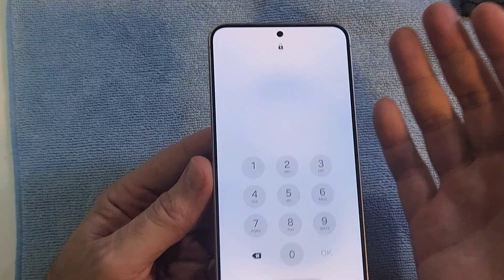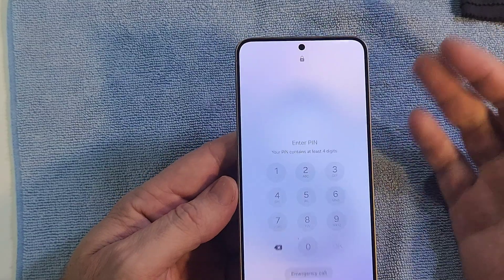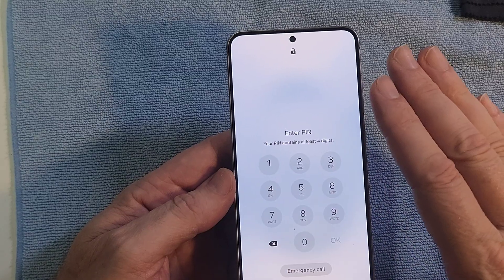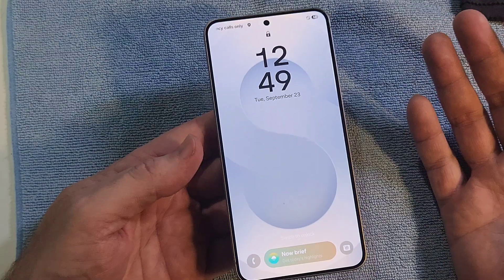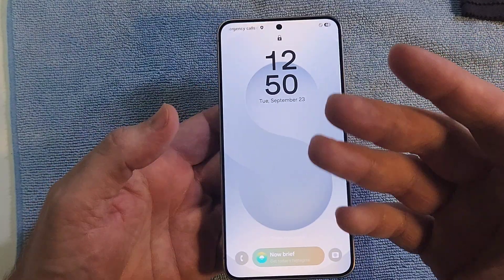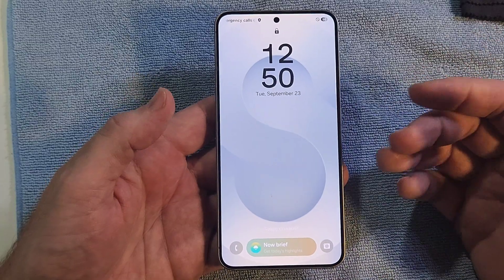What we need to do is reset the phone, but I'm going to give you two warnings first. The first warning is that when you reset your phone, you still need to log back in with your Google or Gmail account — you can't get by that. The second warning is that it erases everything: every app, every contact, every photo. With that in mind, if you don't want to erase your phone yet, it's worth making yourself a cup of chamomile tea, getting a pen and piece of paper out, and writing down the different combinations of PINs, patterns, or passwords that it might be. I've had people in my comments who said they tried that and ended up remembering their passcode. So try that first.